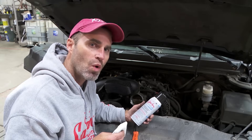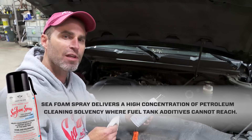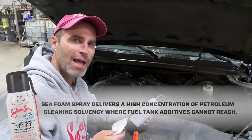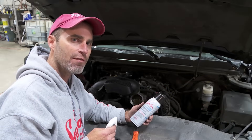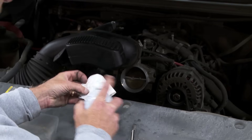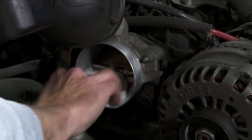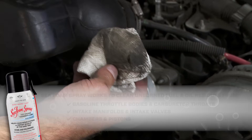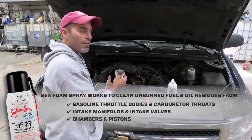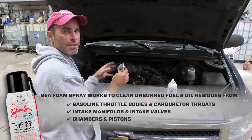Let me show you a clue why we recommend an intake cleaning like this at least one or two times a year, especially for gasoline direct injection engines or GDI engines where fuel additives don't wash over the intake valves. If you've never cleaned your engine's intake, it's covered with this black filthy oil and fuel residue. Oil comes up as vapor from the crankcase ventilation. Fuel comes as backwash vapor or evaporates from the chamber to form soft hydrocarbon residues all over inside the intake.